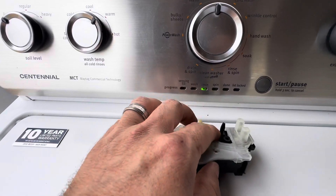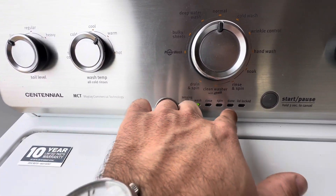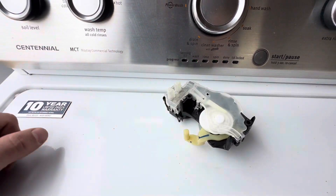You can see that it's going side to side — that's the RPMs it's turning. That's how you test that sensor. But these things are tricky, because if you're throwing that F71 you think, 'Oh, the sensor's bad.'